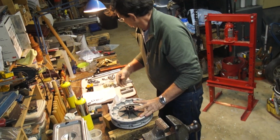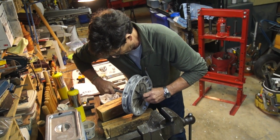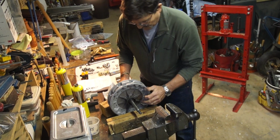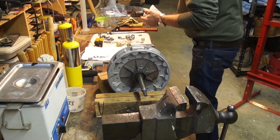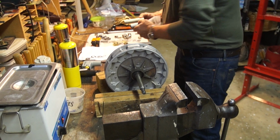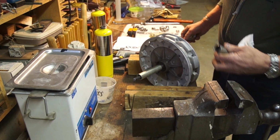Now, to remove this, you take your axle and insert it through the other side, like so. And then you have to take up this space here. There's a nipple you can buy at any hardware store. Depending on if you leave the top hat spacers on, this one's 4 inches, but it would be too short. These two here are sold by CycleWorks, but this one is 4.5 inches. We'll put that on there, and you can see that there is space to catch the threads.